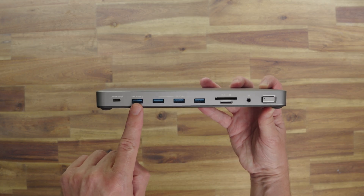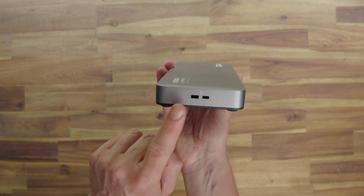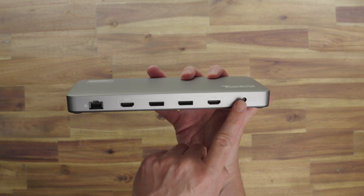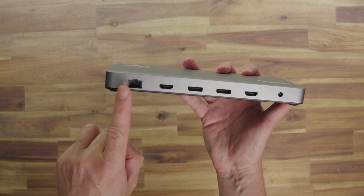There's also a USB-C port on the front end which provides 5 Gbps transfer speeds and power too. On each side you've got the Kensington lock and the upstream USB-C port for connecting 100 watts of power to your laptop. So not only can it drive the displays, but it can keep your laptop charged too. On the back you've got the power supply port, two display options using either HDMI or DisplayPort, and a gigabit ethernet port.